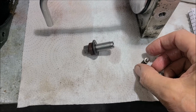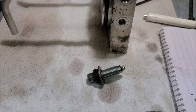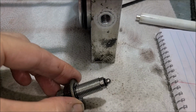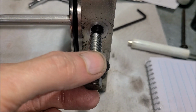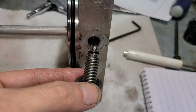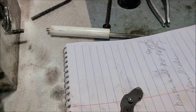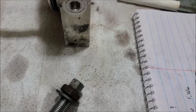Let's test this theory. Hang on, I need two hands again. Okay, so you get the idea. Right there it is holding. I really need one of those magnetizer-demagnetizers. But if you get that magnetized, get up in here, put it in place. Hopefully that would be the trick. I think that's what I would try to do. That way you wouldn't lose it again. But you'd probably want to get something to make it a little bit stronger, because if I tap it, it falls off. So getting a stronger magnetism on that spring or the ball might be an option.